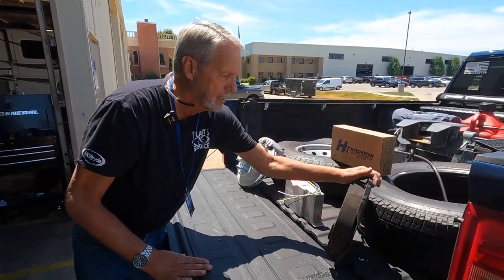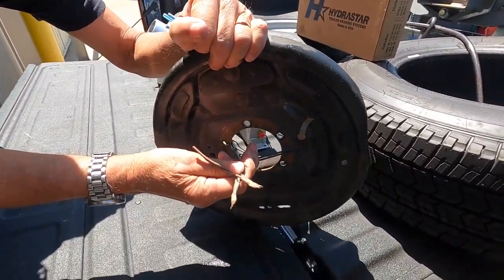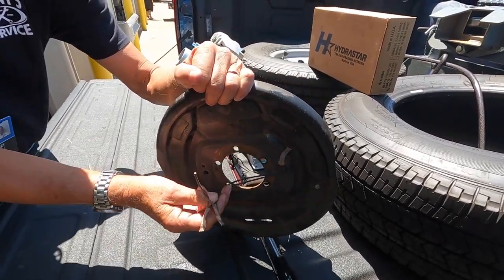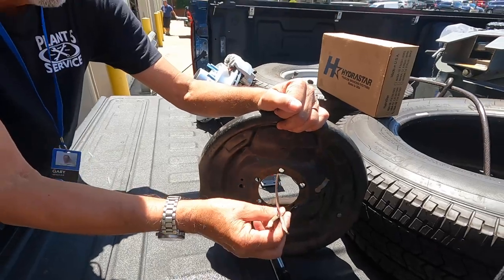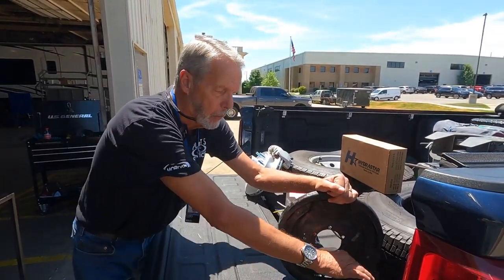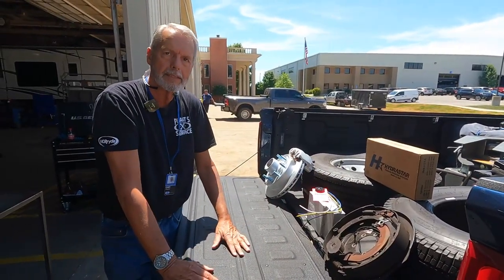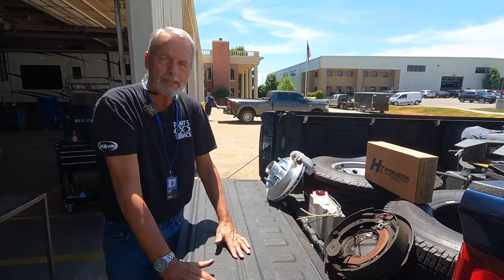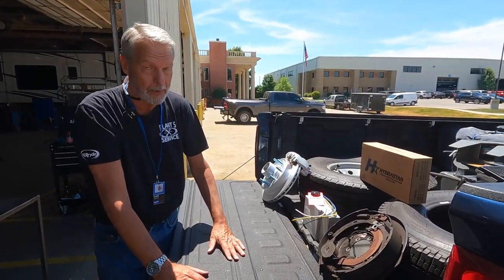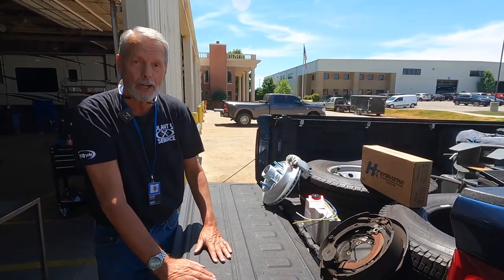You have brake pads there, they get wet, they're not going to function to 100 percent. Another problem is there are brake wires that are exposed, so if you go over one of those alligators in the road or anything that could yank that wire off, you may only have three brakes working and you don't realize that until you come to a situation where you need them. As trailer operators, it's not a matter of if — it's a matter of when somebody's going to pull out in front of you.